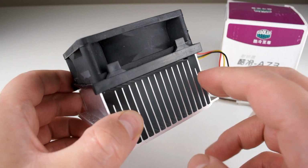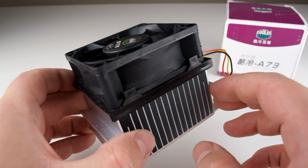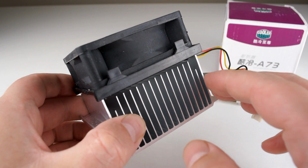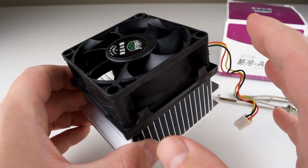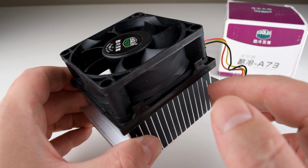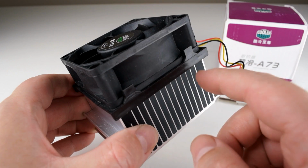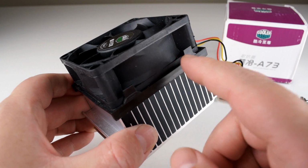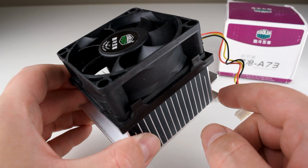And you've seen the results when running something that's purely CPU bound. It can't handle the processor and the CPU throttles. So I see these as more suitable for a 2.4, 2.6, maybe a 2.8 GHz Pentium 4. 3 GHz is definitely too optimistic, and we did use a Northwood core, so if you're using one of the Prescott processors, it will be even worse.